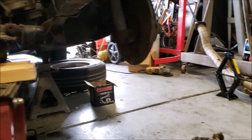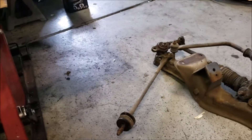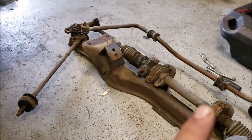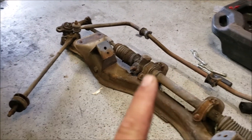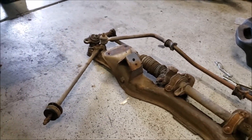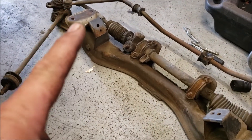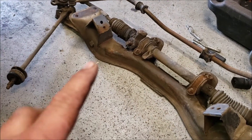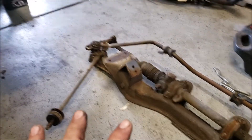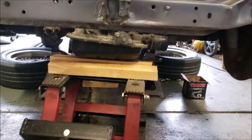Another issue is going to be the cross member, because it will make contact with the engine. The oil pan sits almost dead center here - the middle of the oil pan pretty much lays across the rack. I'm going to see if I can add spacers to the cross member to lower it a little bit just so it goes under, but I kind of doubt that.